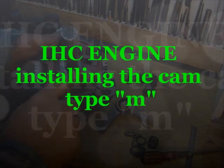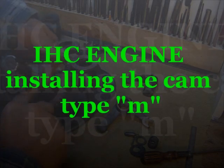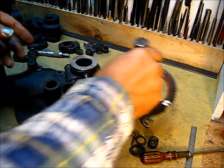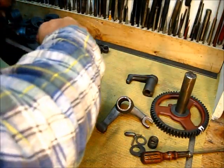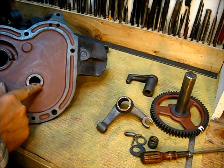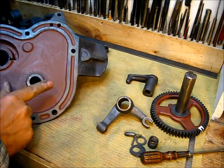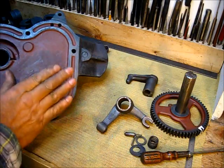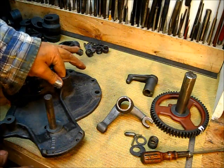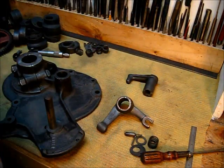To assemble this gear, observe that seat right down there — that it's smooth with no burrs or restrictions. On the backside, you want to observe that seat right there, that there's no burrs or restrictions. I have run a wire brush through there; it's really clean.